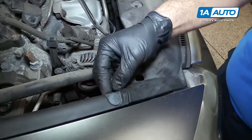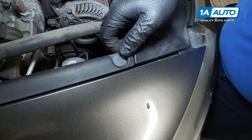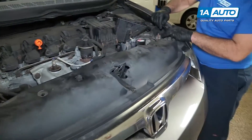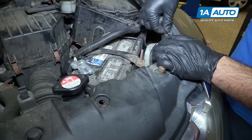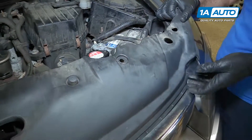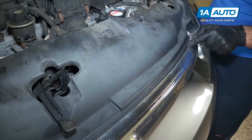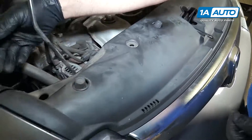This is actually clipped underneath this little piece of trim here. You can pull it up and sort of pop it out, and do the same on this side — just kind of pull it up, pop that pin out, kind of push it this way a little bit, and lift that up. It's got a lip that's kind of pushed into the grill, so just kind of pull out and pull this trim out.